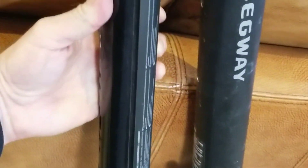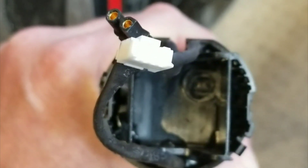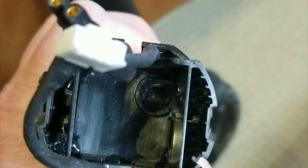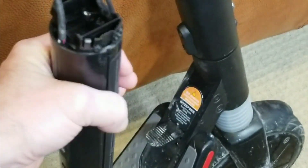All of them share this internal battery. Inside there are 20 lithium-ion cells — 18650s. If you void your warranty and unscrew here and here, you can get into that tube and extract the battery. Why would you want to do that? If your battery is failing and you want to put a new one in, that's a good idea. When you extract the battery, if it's flashing blue, chances are there's still some life to it — cells are probably reasonable. But if there's no flashing blue light, something is probably fried and the cells are gone. I'll show you what's inside and how to get in, in case you want to salvage some cells.